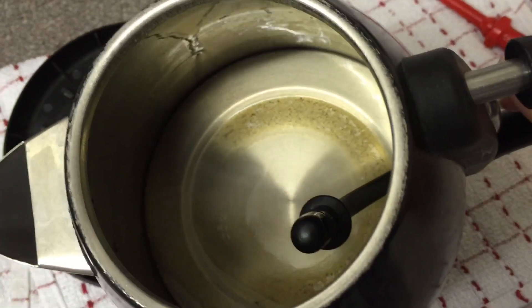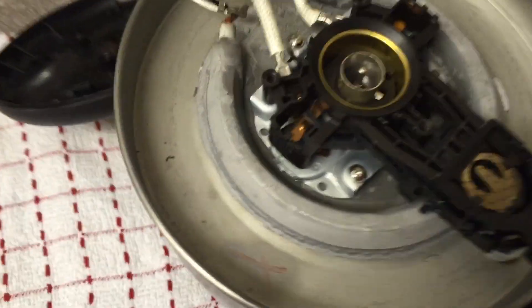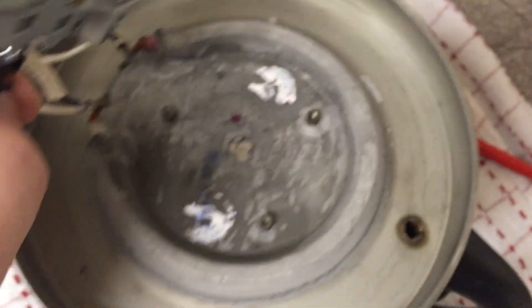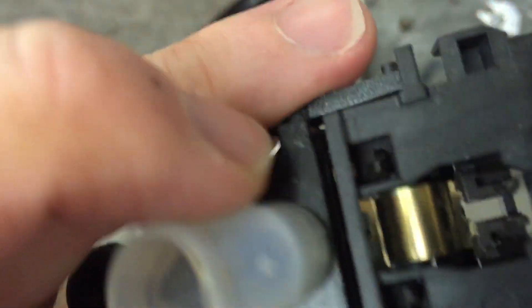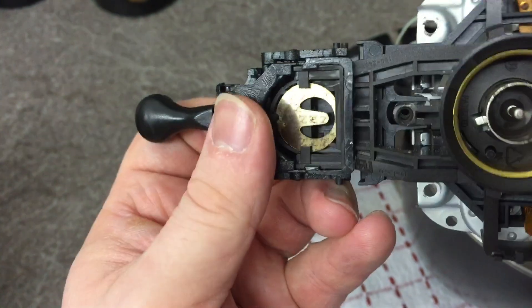So there's your three kilowatt element, and all that does is it heats up this plate at the bottom where the water is. There doesn't seem to be any water in the bottom of this - I don't think it's water that caused the problem. This switch mechanism contains a bimetallic switch. When it gets hot enough it clicks and turns off the power to the element. I think this is for thermal overload, and this is a little pipe that comes from inside the kettle. When the steam comes through that, it heats up this - it's a little rubber pipe that goes in through that.